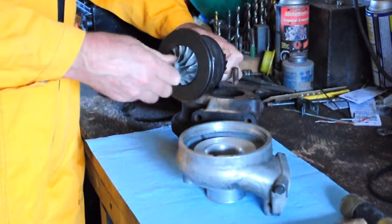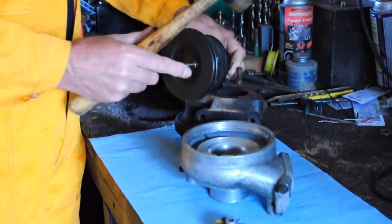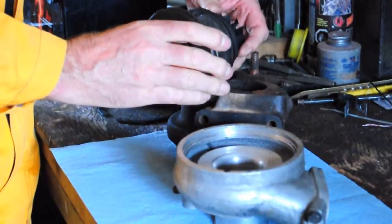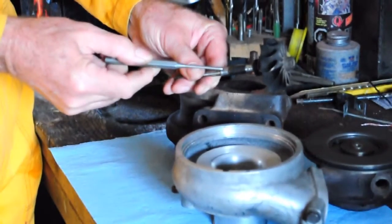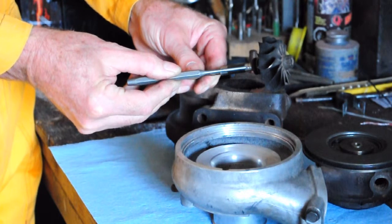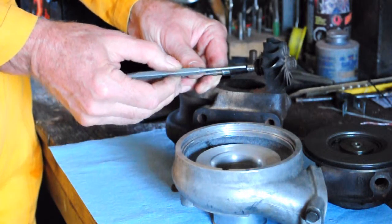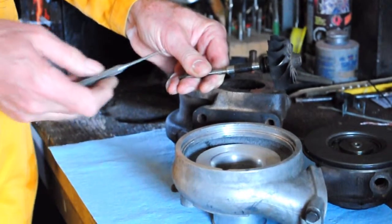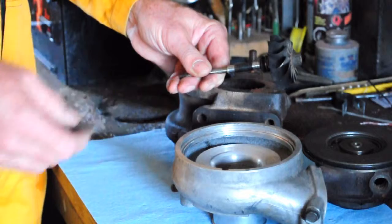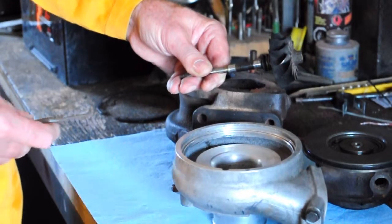So that's the problem — let's see what causes it. We'll take this apart. And here's the problem: we've got wear on the impeller shaft of around 10 thousandths of an inch, and more wear here of around 30 thousandths of an inch. There are supposed to be bronze bearings with an oil feed that goes through here and provides lubrication. This is what typically wears out on turbines, particularly this one — the original was a cheap Chinese unit and it lasted about 10,000 kilometers. Kind of underwhelming.